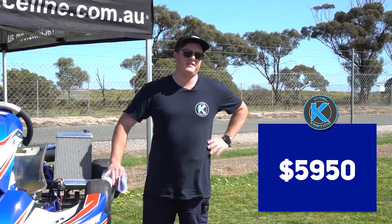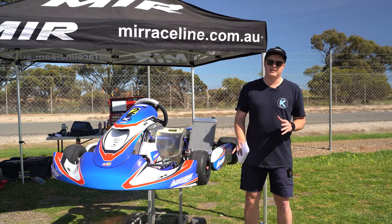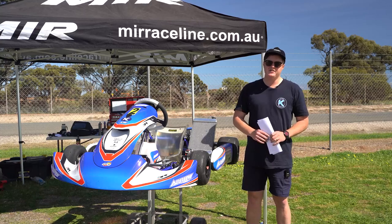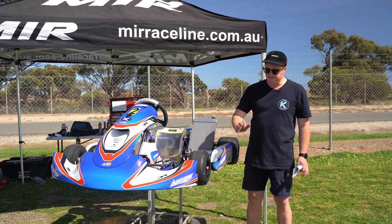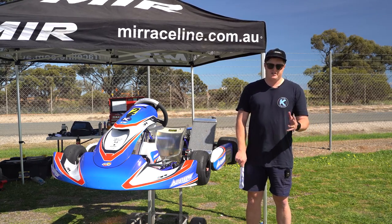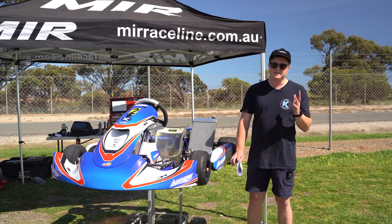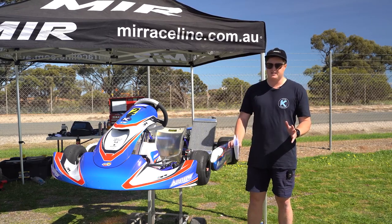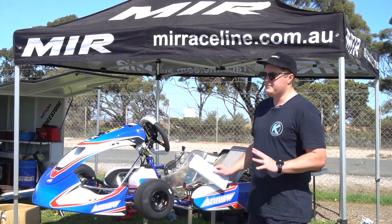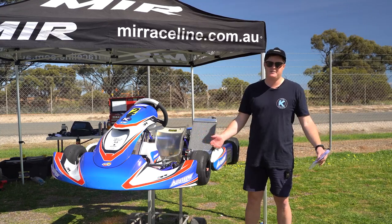These retail for $5,950 — $700 to $1,000 cheaper than the European karts. They don't have the magnesium carriers like the OTKs and Kart Republics, or the AMV wheels and hubs — they have their own. But Keegan Fraser ran this exact setup at the national championships — Douglas SE wheels, Car-Tec hubs — and won a national championship in KA3 Senior. Susan Harlow swapped to AMV wheels and hubs like the Kart Republic, and Brad Jenner typically uses MXC wheels and OTK hubs. The factory team drivers are jumping around with wheel setups, but they came second, third, and won in the championship. It works.